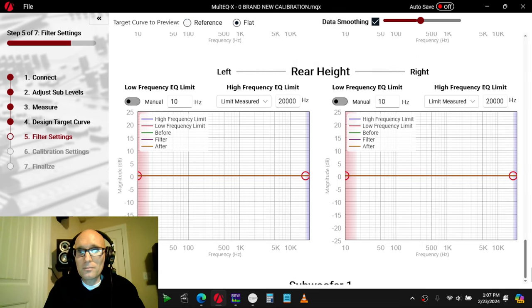So you may time align, measure yours, and it was 6.8. Then you put 6.8 into miniDSP, or you can do this in MultEQ-X. Either way, whatever system you're actually using, that to me is the room curve, right? So when you play movies with that understanding, that is the curve and rise that the room is giving to these subs, and the subs themselves. So that's what's going on with the room. You put that in, that's when you get a completely natural sounding bass from your subs. It sounds absolutely incredible. You are not under bass and you are not over bass.